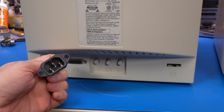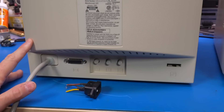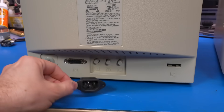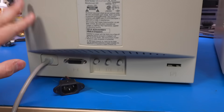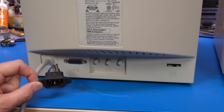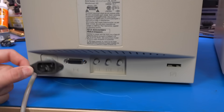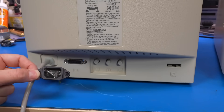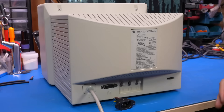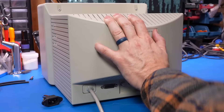The funny thing is, when you take the Apple monitor apart, where that rectangular piece is is actually designed to hold a standard IEC input jack — just like this one I stole off an old dead power supply. We can take the fixed cord out, install this, and then the monitor will have a perfectly fitting IEC mains input power jack. It's a huge upgrade, especially because I'm moving these monitors around and I don't want that cord floating around where I could trip on it. This is absolutely a worthwhile mod if you have dead power supplies to salvage these from.